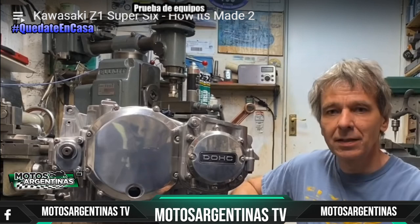Back in the garage, I got my little bit of plate that I just cut out and offered it up to the engine to see that it was big enough. As you can see, it's straight, it needs to be curved, and it also needs to be contoured to fit the side of the engine. To put the curve in the sheet of aluminium, I gripped it in my vise and just pulled it by hand. It's quite stiff, but I managed to do it.